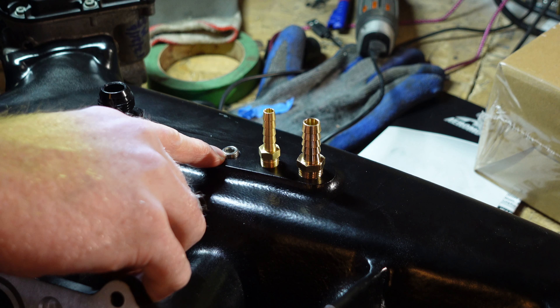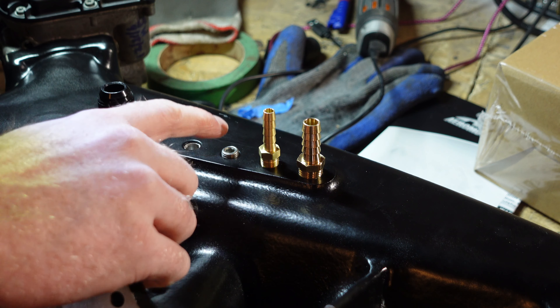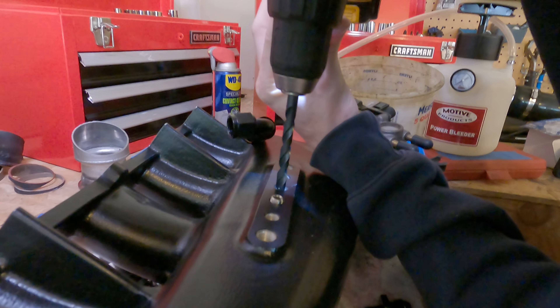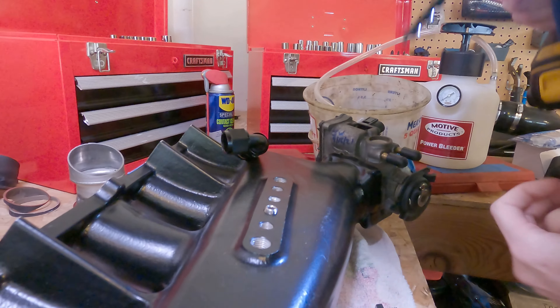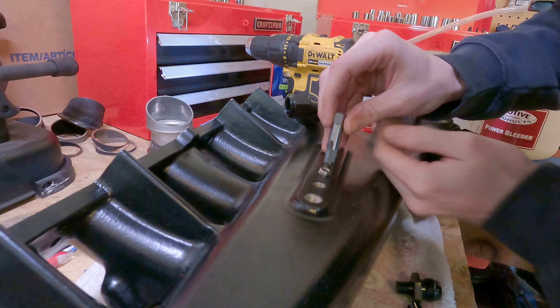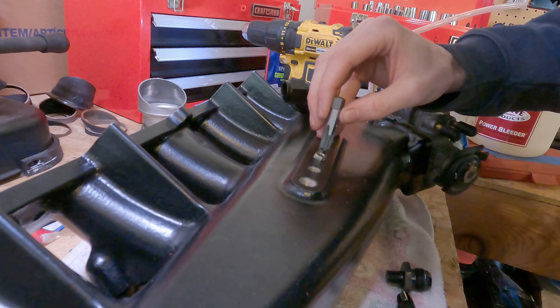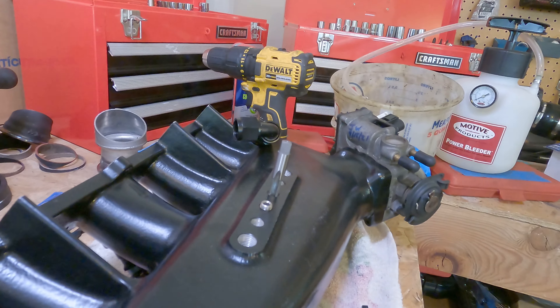On the bottom of the intake there are a series of holes for 1/8 inch MPT and 1/4 inch MPT, and this is where you generate your vacuum from. Each one of these holes is where you can hook up vacuum accessories. You can get these little barbs off Amazon, or you can see there's a block-off plug here for an unused hole. A note here: I didn't know much about MPT threads because this is pretty much the only time I've ever had to deal with them.